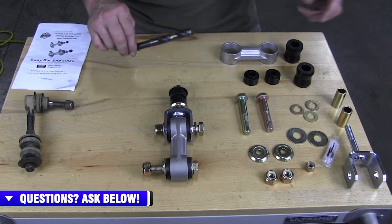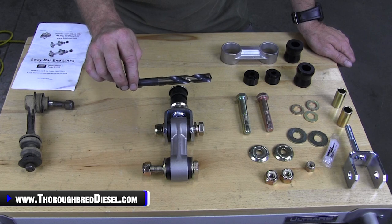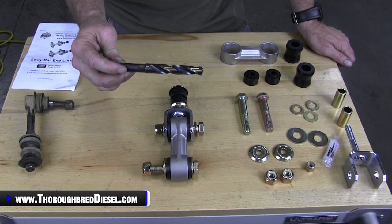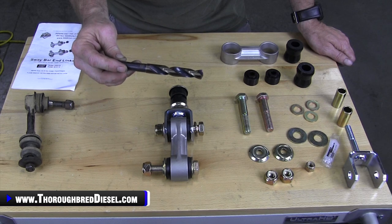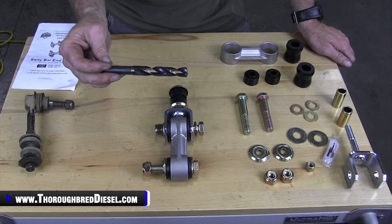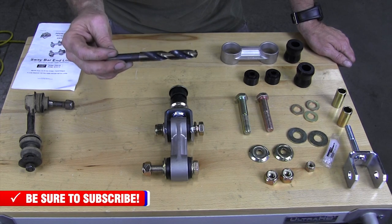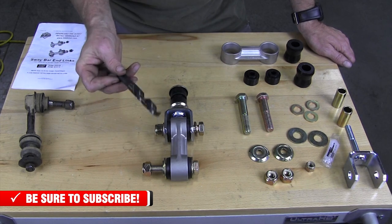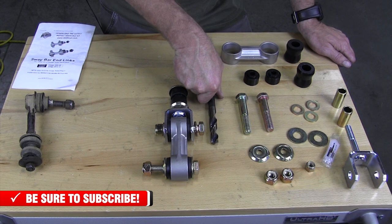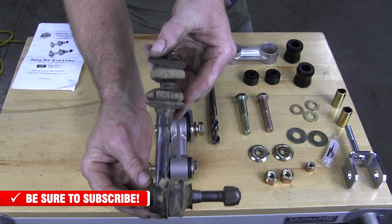Normal hand tools are all you need here, but something that may trip you up on the 2000 to 2009 models: on the axle mount for the BD sway bar end link, you may have to get yourself a 9/16" drill bit and drill that hole out on the axle for the BD sway bar to attach to. But if that's what we have to do on this truck, that's what we have to do — I think we're going to have to do it based on the size of the hardware.